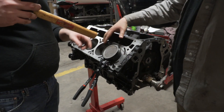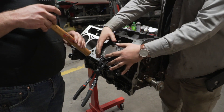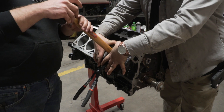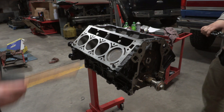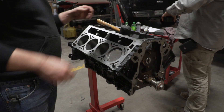When you got your piston ring compressor set up, I found that just one good hit is the best way to get it in. If you try to work it in slow, a ring will pop out underneath — there's just no way to hold it down tight enough. So you just get it lined up and give it one hit. When you figure out how the tool works, it works great. Just takes a minute to get that part figured out.